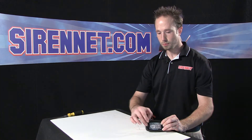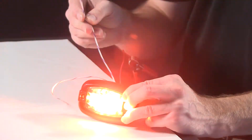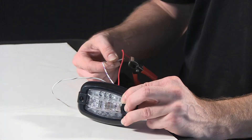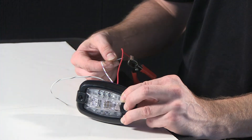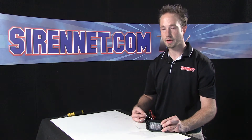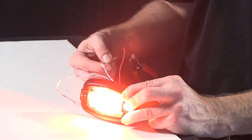The warning has adjustable patterns, which are controlled through Whelen's ScanLock wire — the white with a violet trace. Every time you momentarily tap it to a 12-volt source, it'll advance one flash pattern per touch. The unit offers a variety of patterns and also phasing, so if you'd like your light heads flashing together or alternating back and forth in a locked manner, the V-Series offers that function.